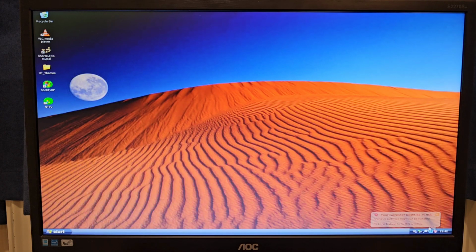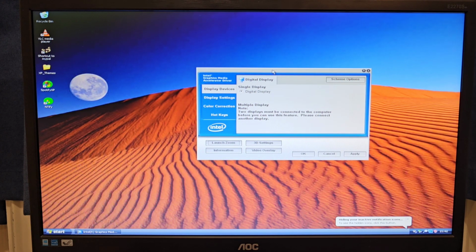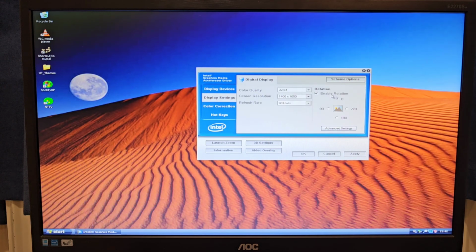The issue I had was the stupid graphics driver here. In fact, it's still not working. I mean, it's working alright, but it's not perfect. This thing has been a headache. Just this little area. Otherwise, it's been okay. The display resolution here, if I show you, this monitor doesn't really agree with any of these resolutions. So when I downloaded the drivers from Dell and Windows, they both didn't work, so I had to reinstall the OS. I didn't think of using DDU, Display Driver Uninstaller or something like that, and yeah, not good.